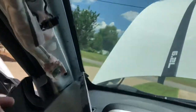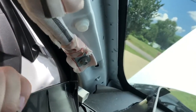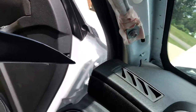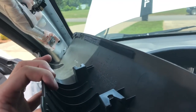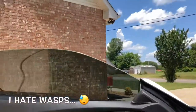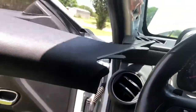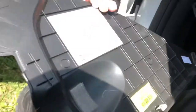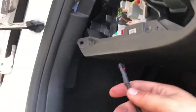There's a little piece right here that came off — just pop it back in. Before you take it all the way out, you'll find a piece attached to that — just pull it. Don't rip the airbag connector out with it. You'll need to hook that back up when you install the new gauge pods. There's a piece off right here — it just has a couple pieces to it and actually accesses the fuse box. I would recommend taking this off before the A-pillar. Next, I'm gonna run the wire up through here and up into the A-pillar area.